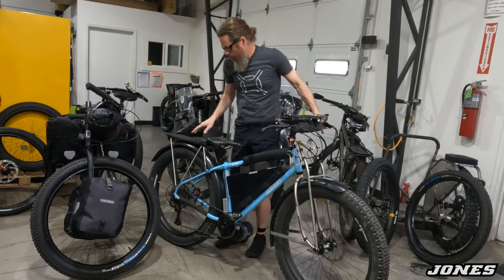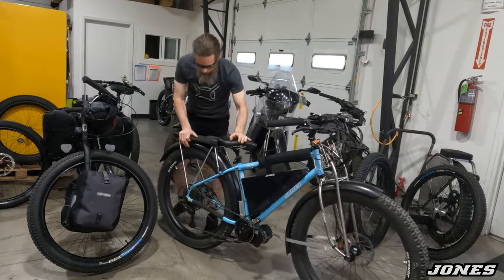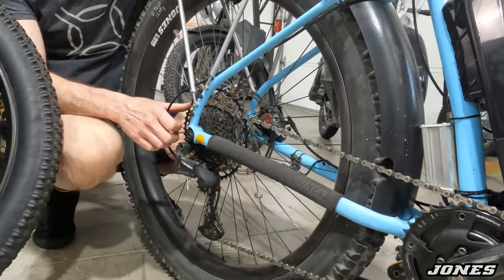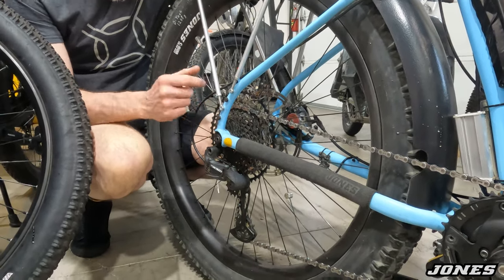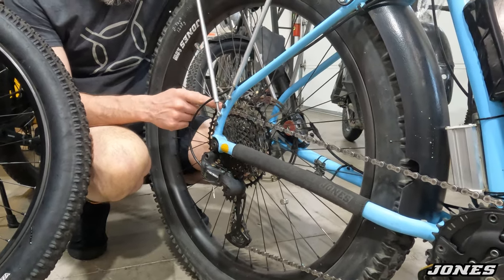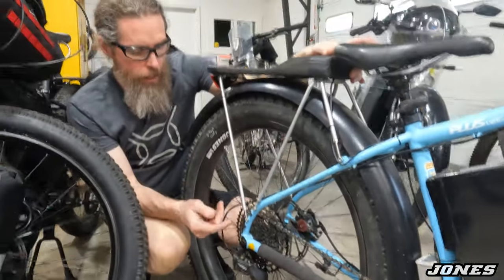This is a rack I've made and a little pad to sit on. This is the V1 bike — the first version — and it has SRAM 12-speed with an 11-50 cassette. All steel cogs or sprockets — this is more durable. Most cassettes have an aluminum large sprocket, which is all right but it wears quicker, especially on an e-bike. You put more force through the drivetrain because the motor is running through the drivetrain.